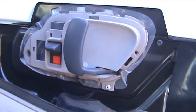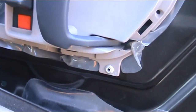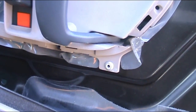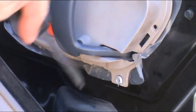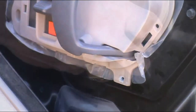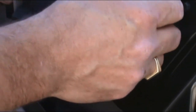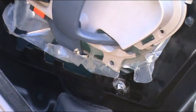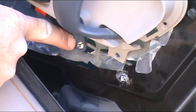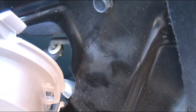The way the door is originally put in, you've got a rivet right there. You're going to have to drill that out — that's the next step. After you get it off the rivet, you've got to push forward. Now you've got to disconnect the linkage. You've got one here; you can see that one in there. This one here you've got to lift out — up and out.